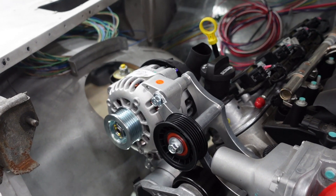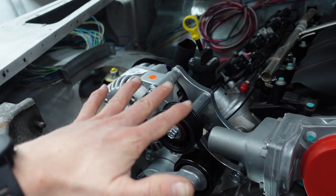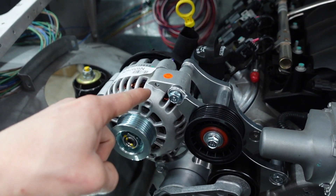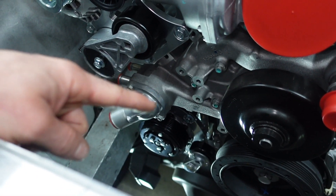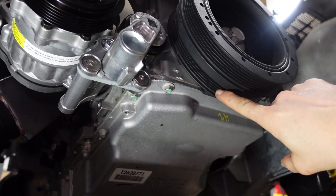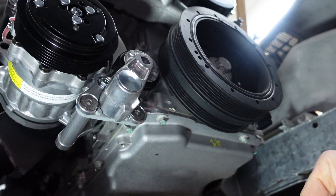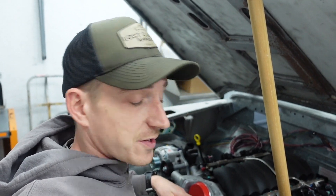One of the things I like about this particular setup is the alternator is up high and the AC compressor is down low. A lot of setups put the AC compressor right up top, and you can also put the alternator down low. My thinking is if we ever do a water crossing or muddy scenario, I'd much rather have the alternator up out of the elements than something non-critical like the AC compressor. The other benefit is we're running a separate belt just for the AC system with its own tensioner — if there's ever an issue with the AC compressor it's an isolated system and we can just delete the belt. AC is nice for comfort but definitely not needed to get us out of a situation, so I'd much rather have the water pump, power steering pump, and alternator separate from the AC compressor.